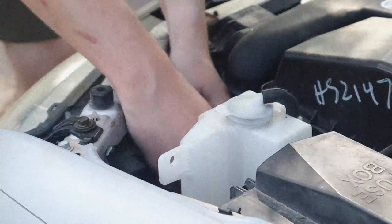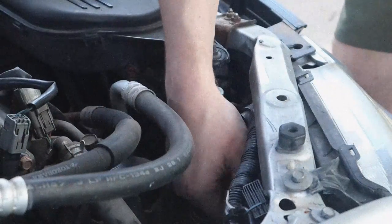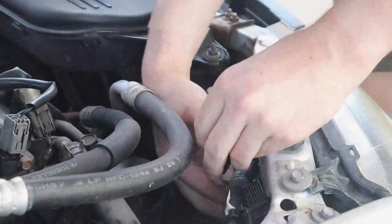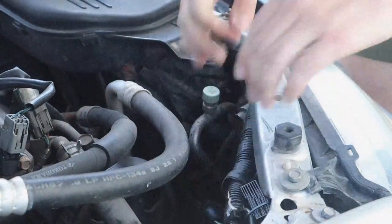Once you have the correct bulbs, like I just discovered here, it's as easy as removing the old ones, plugging in the new harness that sometimes has a ballast, and then it's plug and play from there. Installation is as easy and smooth as my brain.